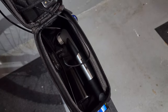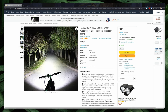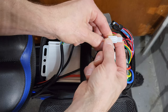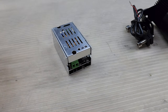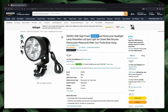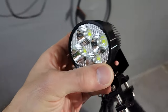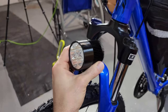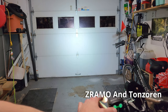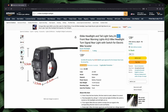I've also tucked my headlight battery in the phone bag — I definitely did not like it between my other battery and frame. This Tanzerun light is rated at 4,000 lumens, one of the brightest on the market. The downside is it runs at 8.4 volts, and since the headlight output at the speed controller is 48 volts, I'm still choosing to power it separately. I do have a buck converter that would allow me to step down the voltage if I decide to hardwire, and I also picked up a 2,000-lumen 48-volt Zeramo headlamp. In testing, my existing headlight had a brighter and wider output, so I'll stick with the discrete battery for now. Let me know if you want to see me hardwire the headlight.